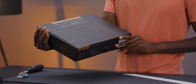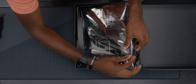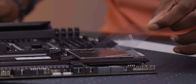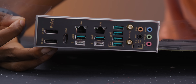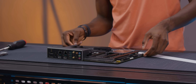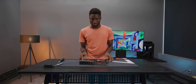This is Asus's new ProArt motherboard. It comes with three months of Adobe's Creative Cloud for free, so you can kind of get a sense of who they're aiming at with this board. It's got some heft to it — it's a very solid board. I want to put together as much of the computer as possible on the board in front of me before I try to put it in the case. So I'm going to put the CPU in, then the RAM, then the SSDs, and then we'll see about the cooler.